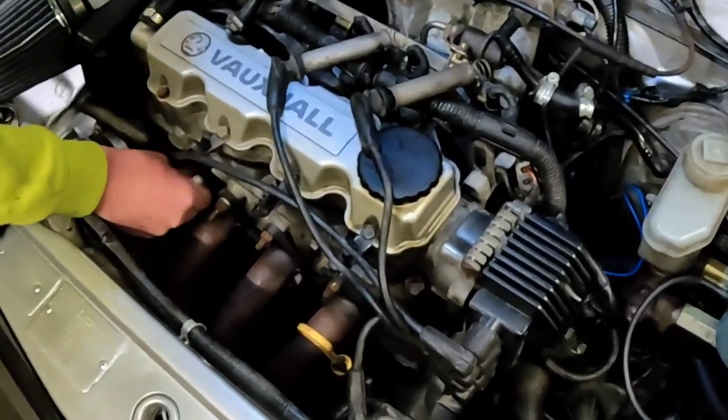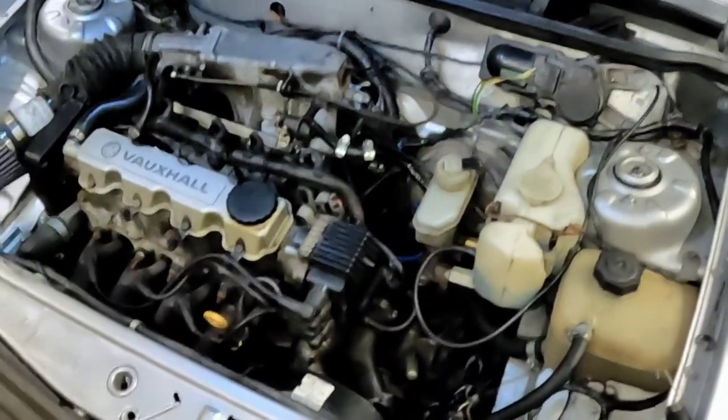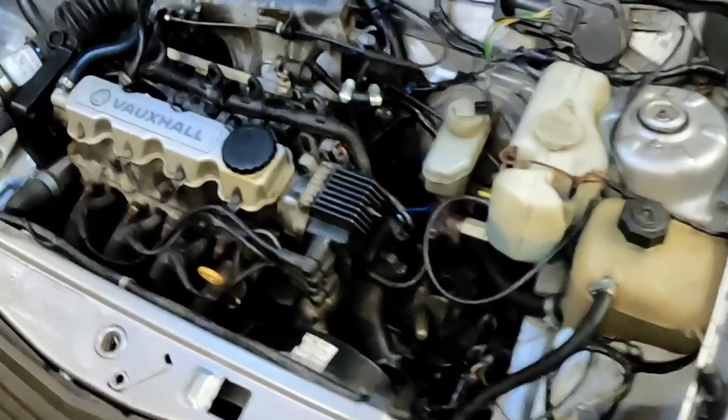All right. Yeah. Obviously, must be. Let's try again now that we've got some nice dry spark plugs. Battery terminal back on. That'll have erased all the memory in the ECU, so it won't be getting duff information from a knackered coolant temp sensor. Okay, Nova, please start.